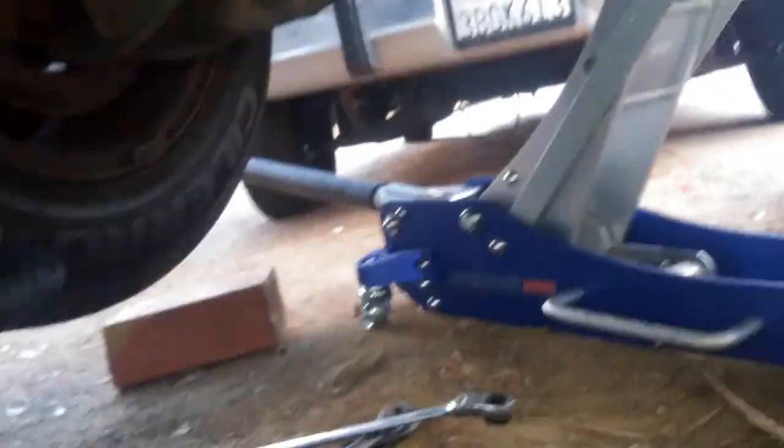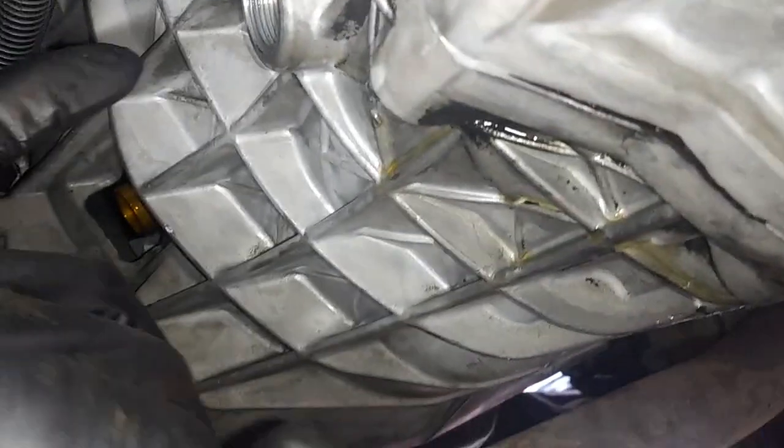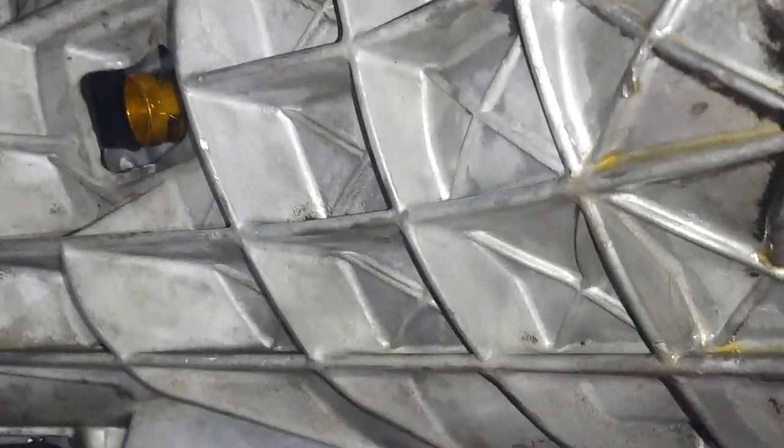So once you put in your fluid, the way you can tell it's full is you need to make sure that the transmission's fully leveled. Mine's tilted, as you can see, from right there and right there. Yeah, those few degrees do make a big difference. So I basically put back the fluid that actually came out of it. Obviously a little bit extra came out when dropping down the transmission. So what you can do is get a rag and we'll clean up our area.